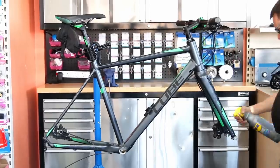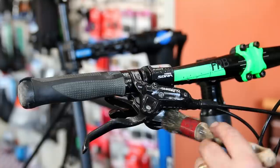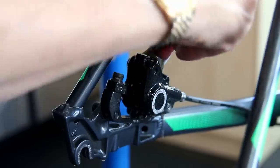You can see here we just cleaned up the pads — we skim them down and get all the residue off them. That just makes the brake actuation feel like new again and takes away any squealing the bike may have.